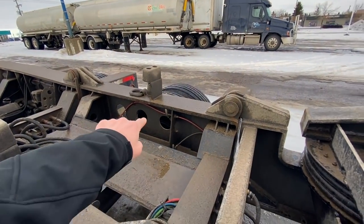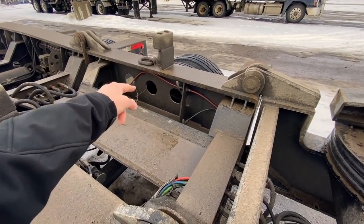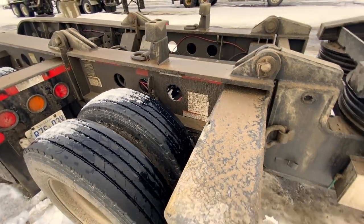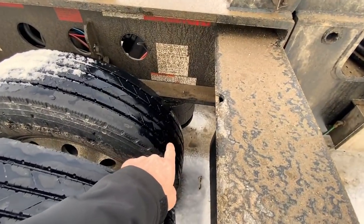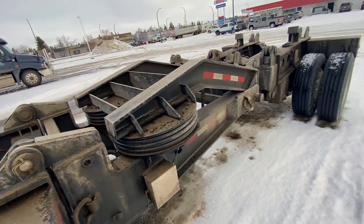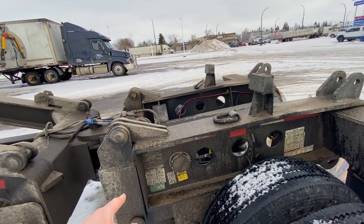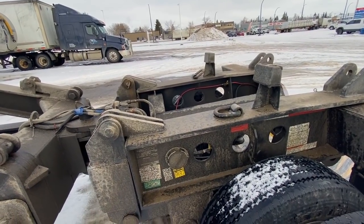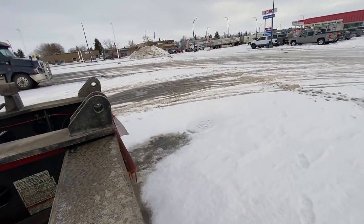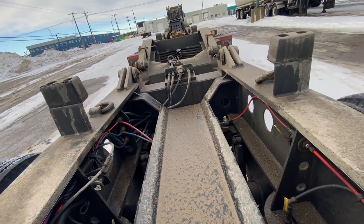When that tap is turned like this, the ride height control is inactive, and this axle shares information with that one — that's how you usually want it on all axles. This one is the same: an intermediate axle, so it's heavier than normal. If it was a final axle, it wouldn't have this.